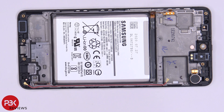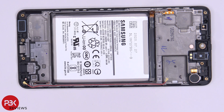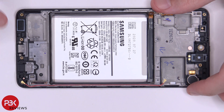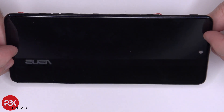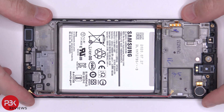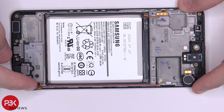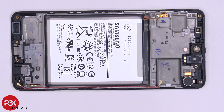If you needed to replace your screen, all you need to do is pry your back plate off, remove the screws, remove the back housing, disconnect the battery cable, and then disconnect the cable for your screen. You would heat up the front of the phone to loosen up the adhesive underneath the screen, then pry your screen off the mid frame. Apply your new screen, making sure you run your cable back through the opening in the mid frame, then reattach your cables and reverse the whole process.